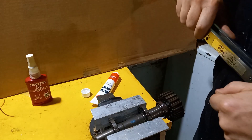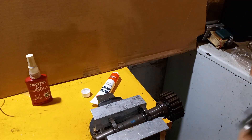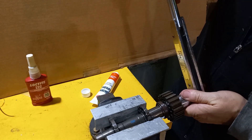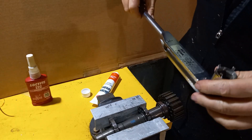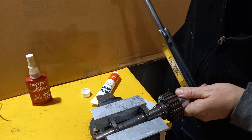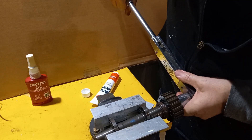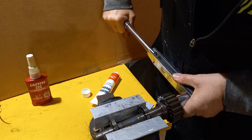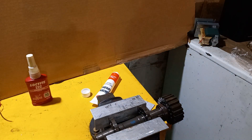This is just a weak, low-strength thread locker so just one drop. Set to 70–71 newton meters, torque spec is 65 to 75. It's definitely harder than that to get off now, which confirms it's done up properly.